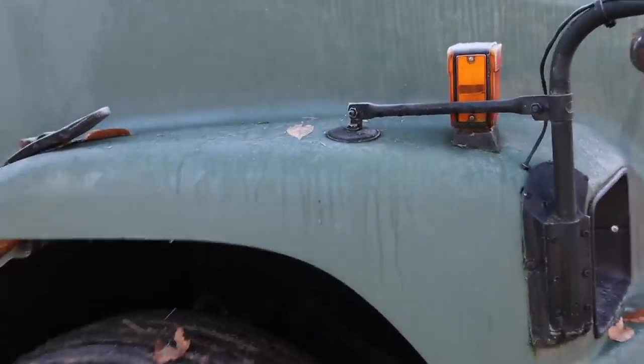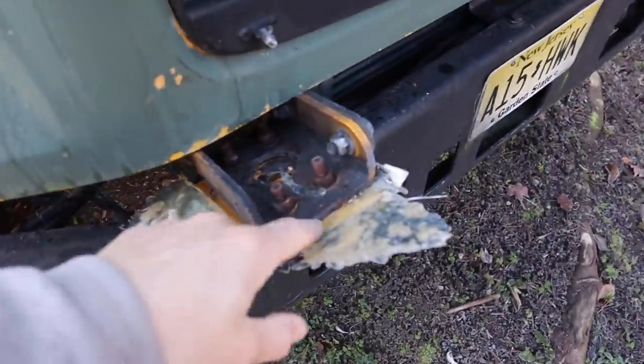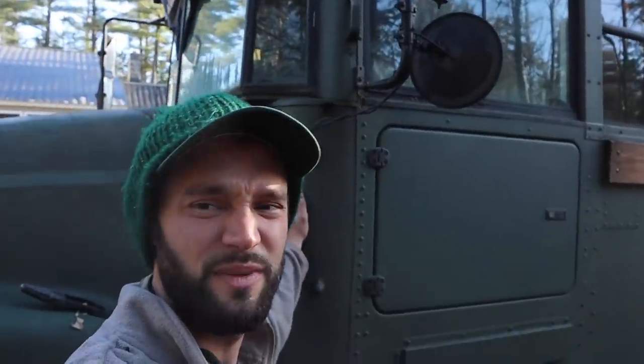The big issue is the engine. Not only did Navi split the hinges off — so it's just a loose hood — it won't start. It starts intermittently: sometimes I'll turn the key and the engine will kick over, sometimes I turn the key and it does absolutely nothing. I have no clue why. My dad doesn't have any clue why either. It could be a starter, a relay, or a bad ground wire. We're going to test through it all and try to figure it out. You've been neglected for like two years now, Navi — we'll take care of you.